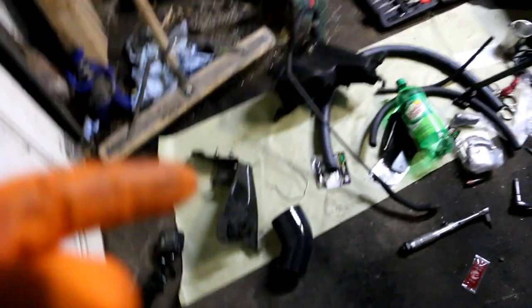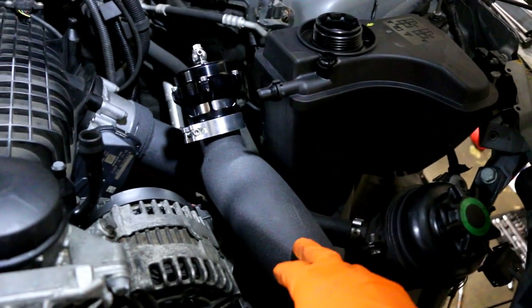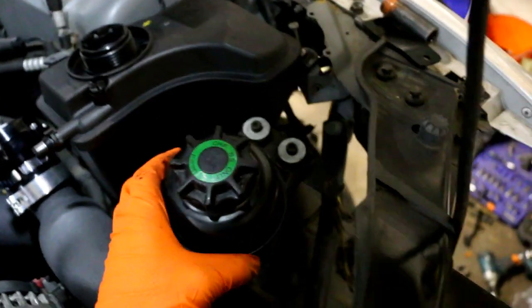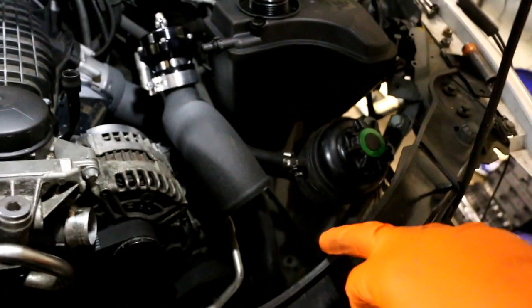Removing that bracket worked like a charm — the 335D coolant tank lined up perfectly with two existing holes in the car body. Now that it sits up perfect, the charge pipe doesn't interfere because I bought the 335D relocation charge pipe. All I have to do is make a bracket for the reservoir to stay in position, extend the coolant hose, extend the coolant level wire, and this little wire that used to run across the radiator will now have a shorter path — just from here to right here.